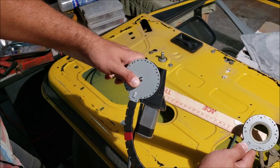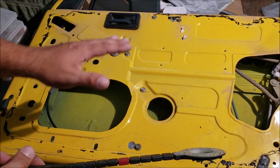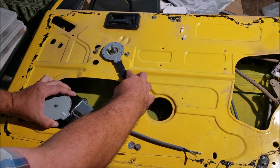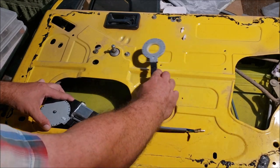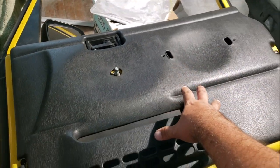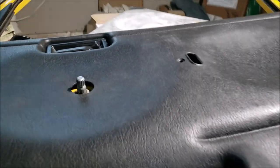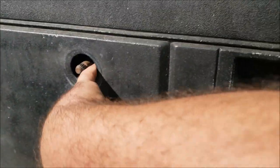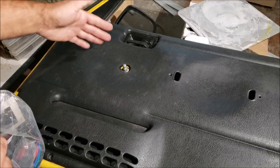On this Jeep door, we're going to have to bend it a little more than the 300mm minimum. You need to roll the window down with the glass in, then put the door panel back on a couple of times. The first thing you do is get comfortable, because you're going to spend about 15–20 minutes figuring out how to mount this motor without it hitting anything. We only have a small area to work with. With the door panel snapped in its normal position, we have about a half inch gap and the gear piece is about a quarter inch thick — so we're okay. The stud sticking up three-quarters of an inch is what makes this a difficult door. The old Chevy truck door is easy because there's about an inch and a half of clearance and the stud only sticks up about a half inch.